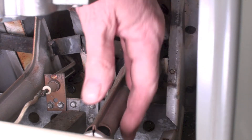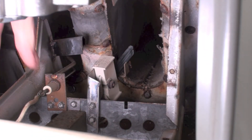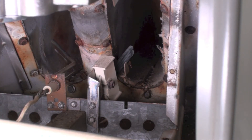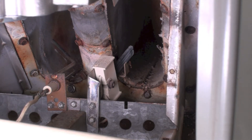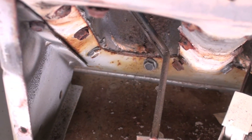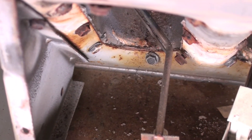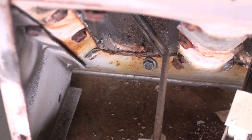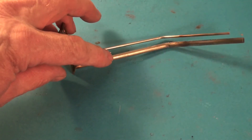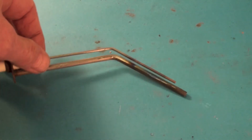I'm going to pull these burners out and we'll take a look. You can see that flame rod in there, right there. It's got a ground and a flame rod right next to each other, because they had problems with grounding in this thing. I'm going to pull that out and we'll take a look. There's that flame rod and ground rod. You can see the bottom rod down here — that's the ground, because it hooks to the body of this — and then this is the flame rod.